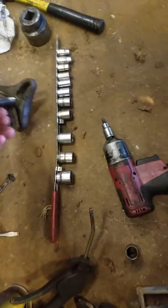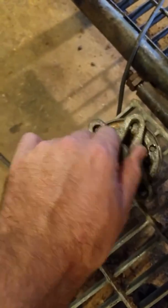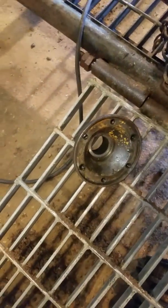It's just like a steering wheel puller basically. Put it on there, use some of your axle bolts through there, and it doesn't take a lot — it shouldn't need an impact or anything. Just turn it out and pull it on out.